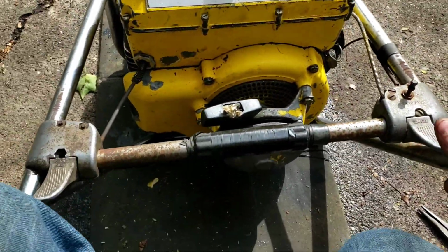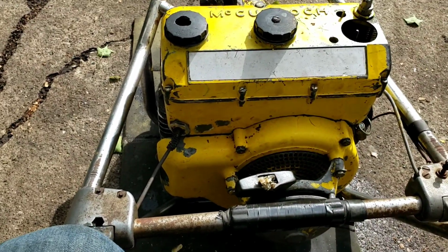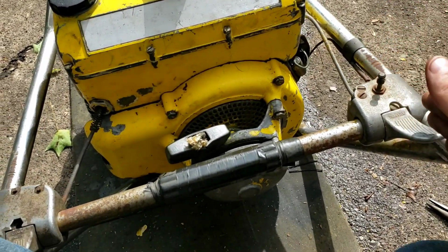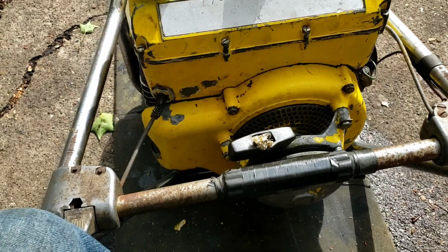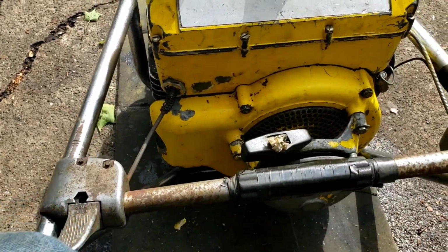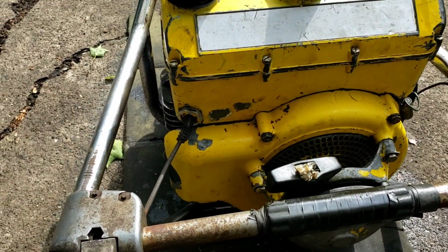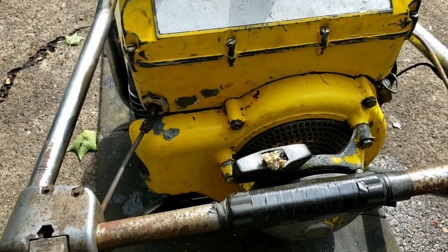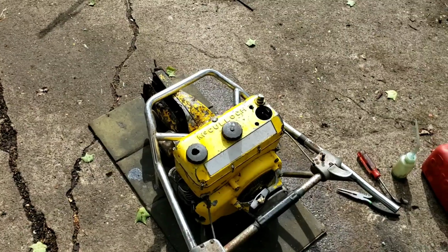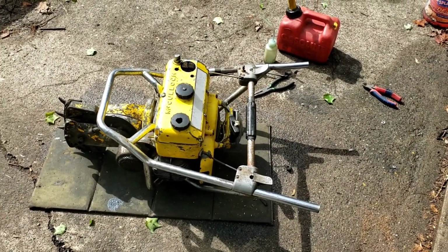I'm pointing towards ignition because closed throttle, wide open is not making a difference. And then you see how it picks right back up like something's trying to work right. So, being that it's open points still, but it was stored indoors all night and it's dry, I'm thinking maybe that could be the coil. But it does run off of tank fuel. And like I say, you can see when it picks up and it really wants to run, and then it just falls back on its face. So, I'm going to do a little brainstorm on this. Hopefully, we'll be back with a good runner.